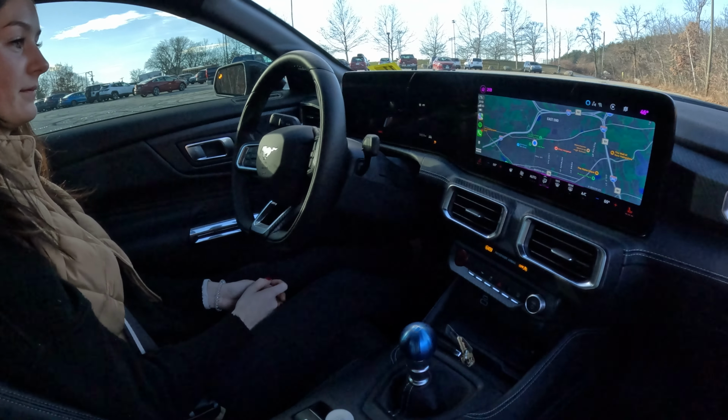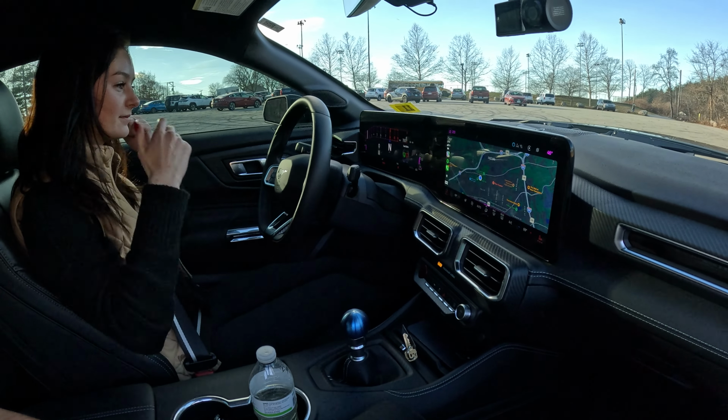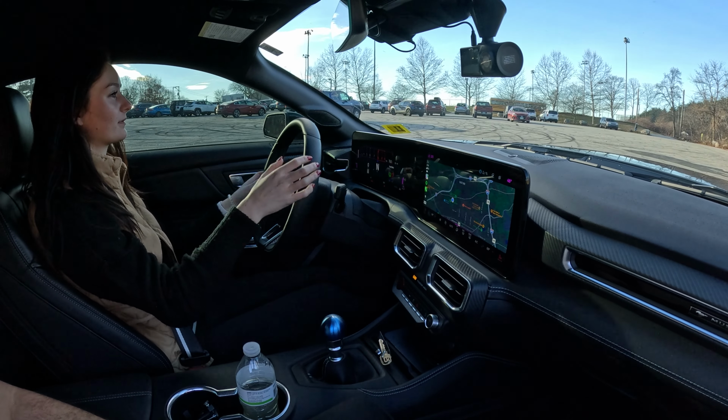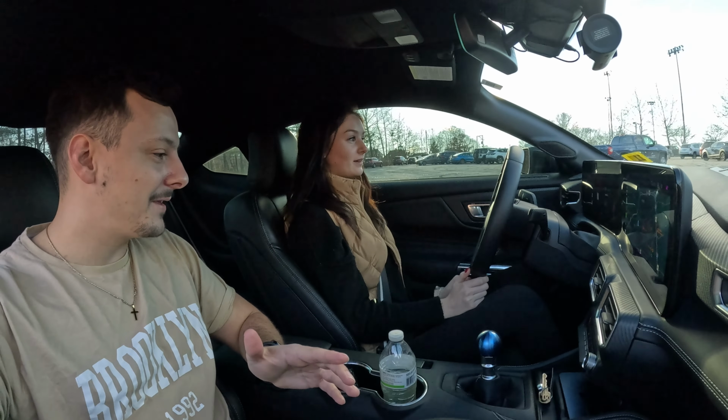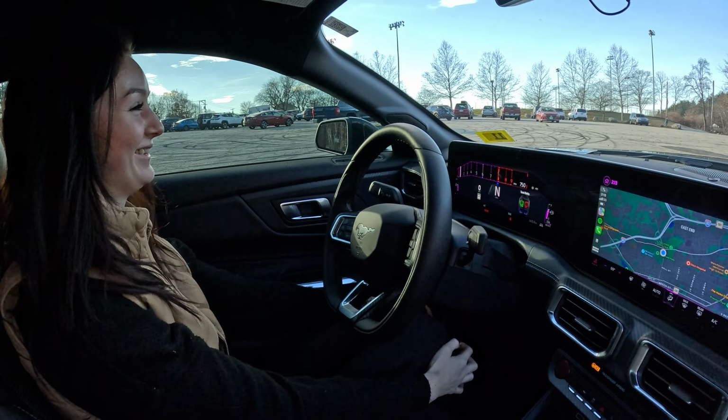Awesome. And now with the clutch in, foot on the brake, you can start the car. Awesome. Now before taking your foot off the clutch, give it another wiggle. Verify that you're not gonna fly forward, and then you can let the clutch out slowly. Okay, now for the moving forward part.